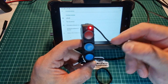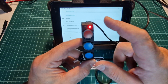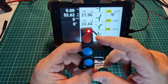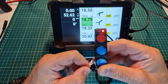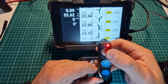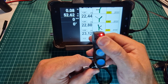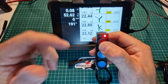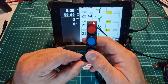Now, another feature of the new model is that it has three programming modes. The first one is Roadbook or music control mode, and you can use it in your Roadbook app. With the toggle, you can move the Roadbook. With this one, you can arrange your trip master, and with this, you can reset. The reset has a little bit of delay, to avoid any touch that you don't want, if you make a mistake and touch it and don't want to reset. So you have to press a little bit longer. And that's it.